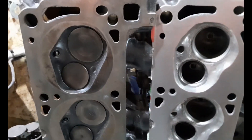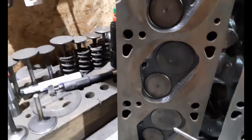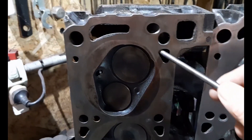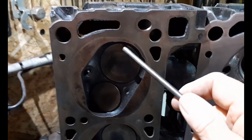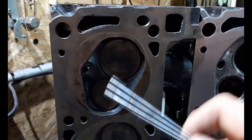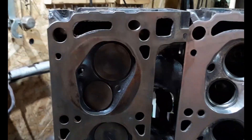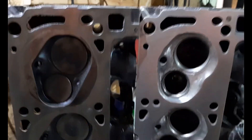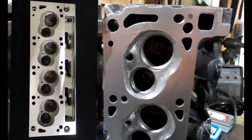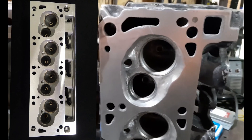Here is a direct comparison between the combustion chambers — the ported cylinder head versus the stock cylinder head. You can see the outline of where the head gasket's been sitting. There's pretty much no chamfer whatsoever on the stock head, and the valves are quite shrouded. That's the complaint you hear about the Aussie 302s. They're a great combustion chamber, good for a boost in horsepower because of the closed chambers and the compression you can get, but you're losing out on flow because of how shrouded they are.